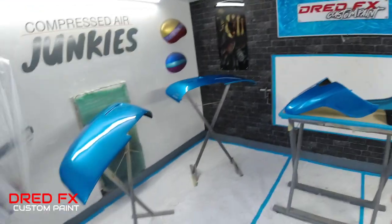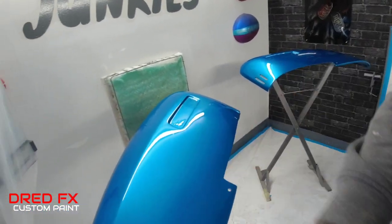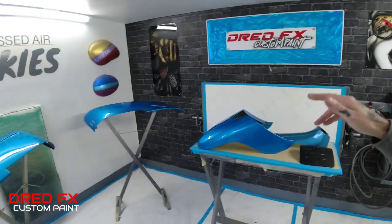So the first thing to do is prep these up. Now because this is clear coated, we can knock this back with 320, knock it all back, see what it looks like. If it needs sealing, I will seal it with some primer sealer — just blast over all these bits in primer sealer and give it a nice coat. If they prep up okay in 320, knock back okay, nib out, fill out the little bits in dolphin glaze — the little pinholes we'll fill them. We can go straight into base coat over the top of this.